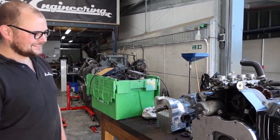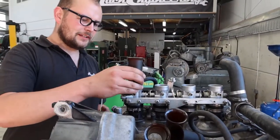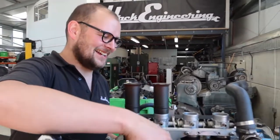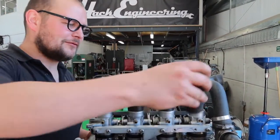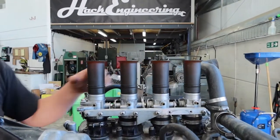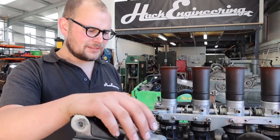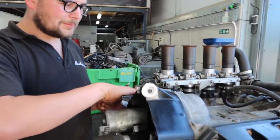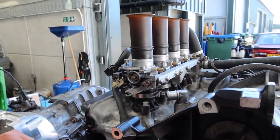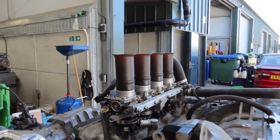To be honest we'll probably get rid of that and run a braided hose line all the way through. We've also had a bit of a muck around with cleaning up the throttle bodies. We're quite limited on room under the parcel shelf, which sits quite low, so I don't know if they'll even fit under there - we may have to angle them over. Complete Engineering Services do an adapter plate to run different trumpets, but I'm quite keen to do that bit here. You can't call yourself engineers and just buy everything off the shelf - hashtag built not bought.